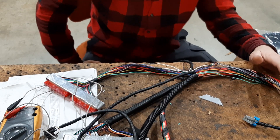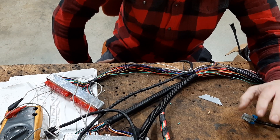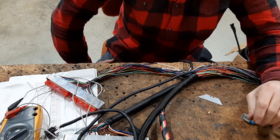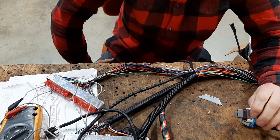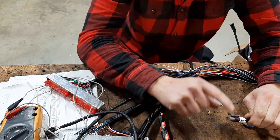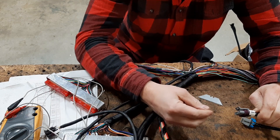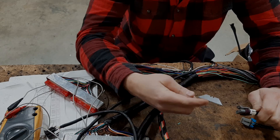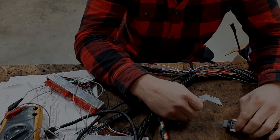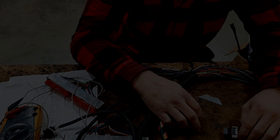After you do that, if you've already installed this harness in your vehicle and determine it was wired like this, you will have to replace your MAP sensor. On every instance I've seen, once you put 12 volts on the MAP sensor through the signal wire, it cooks it. Even if you fix the wiring, you'll still have issues because your MAP sensor is going to read barometric pressure all the time. Replace your MAP sensor after you do these repairs and you should be good to go. I hope this helps somebody out and helps you get your project going.